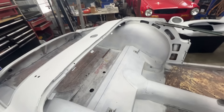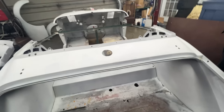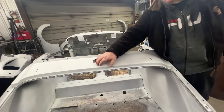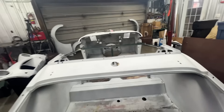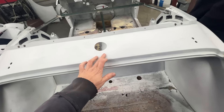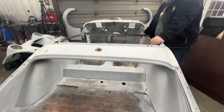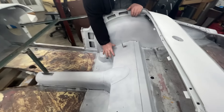Here we have probably somebody who sat for a photo on this panel — maybe in a parade, a parade queen sitting on the rear valance — because it's kind of squished down. It bent here in the middle and here, so we're going to have to straighten that. I might use the boot lid from my '57 to straighten this up. There are multiple areas with waves, so that's going to be a lot of hammer and dolly work.